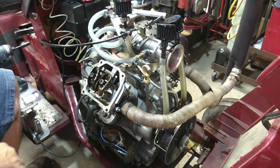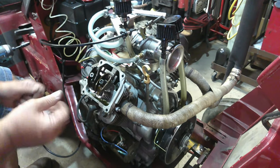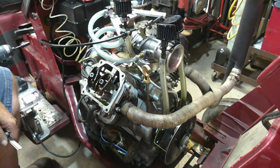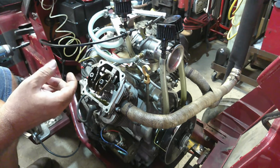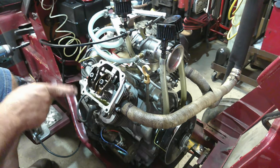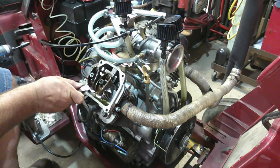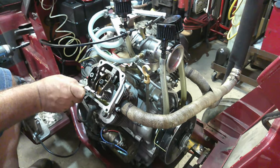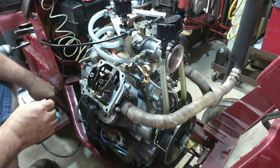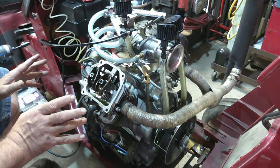What I did was I got it on the intake stroke, valve all the way open. Well, I should tell you what we're going to do. We're going to shim the valves up — put some extra seat pressure on them by putting shims on it and making them tighter. I rolled the motor over to the intake stroke. Lifter's at full lift. Took some feeler gauges, went in here, checked the gap in the spring. And it is about 55 thousandths.